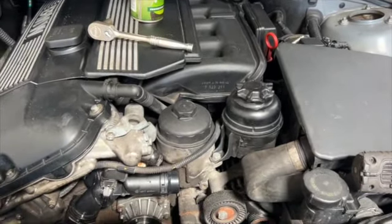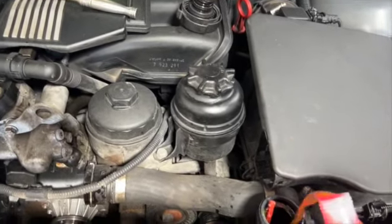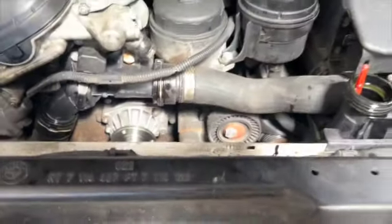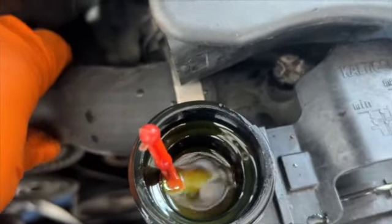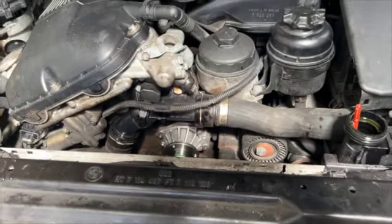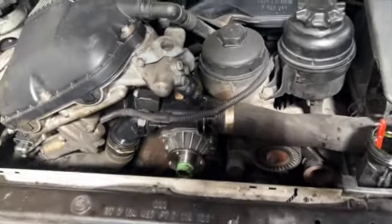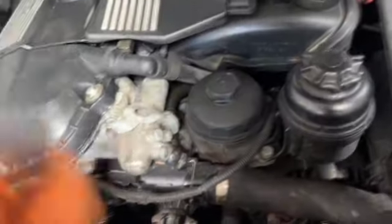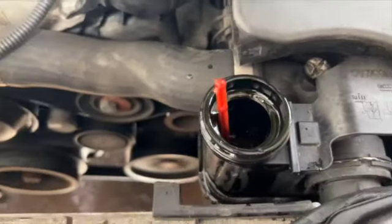Just going to refit the pulleys and pipes, then fill it up and make sure we've got no leaks. All the pipes are on — we're going to spill it — let's fill it up. Cooling is in, we have no leaks as yet. The good sign is when you squeeze it you can see there is still air in the system, but at least it's returning which is good. I'm going to start it up so I'll know if we've got a leak.